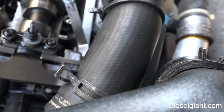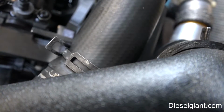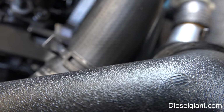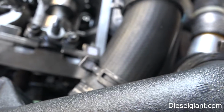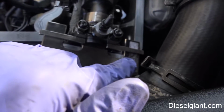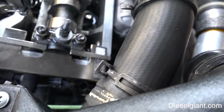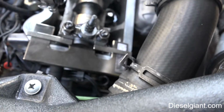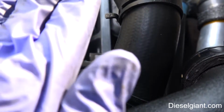And then you slide this gauge under this side, and I can get a 10/1000ths on this side, but I can't get it on this side. So it's almost, this is probably 9.5 and this is 9/1000. But anyway, that's what you have to do to get the cam perfectly in line.